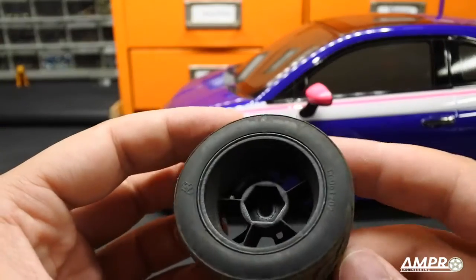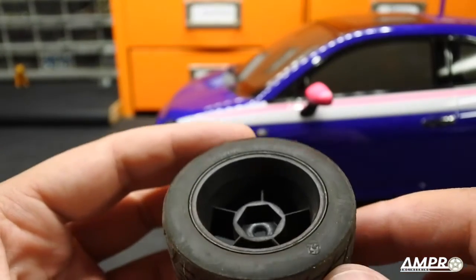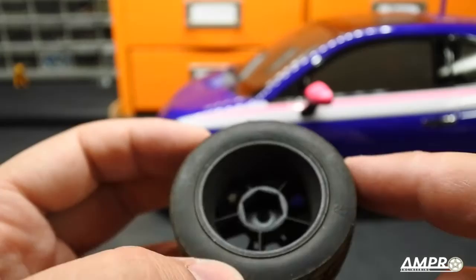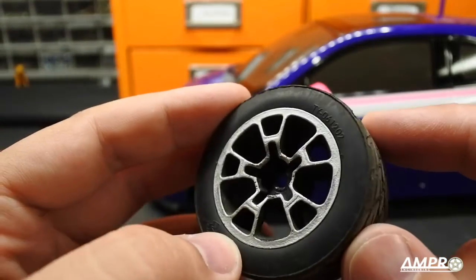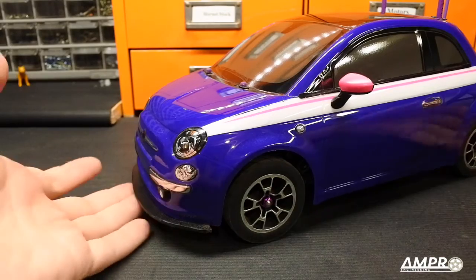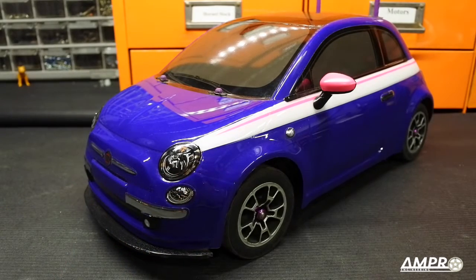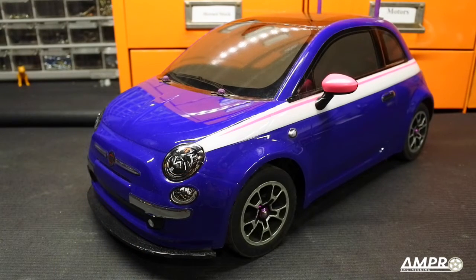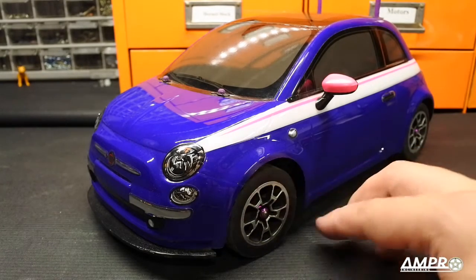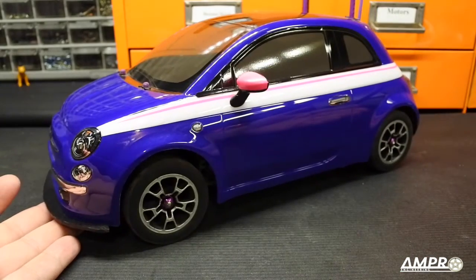Here's the wheel — nothing really spectacular on the inside. There are a number of ribs here that reinforce the main hub. These ribs are half a millimeter thick and provide a tremendous amount of rigidity to the wheel. Again, these are nylon wheels — very durable — and they fit right onto a standard M-class wheel. The offset you see here is a stock offset for probably all of the Tamiya M-series vehicles. They're not going to stick out too far and not going to be inset too far in — just how you would find a standard wheel to be set.